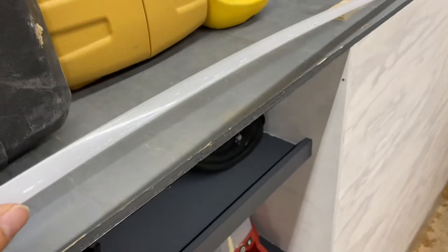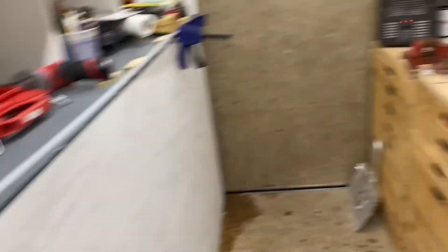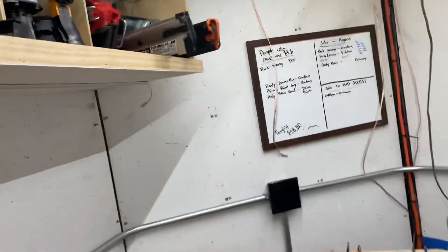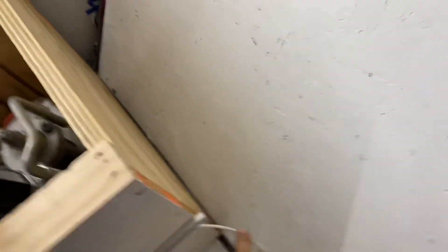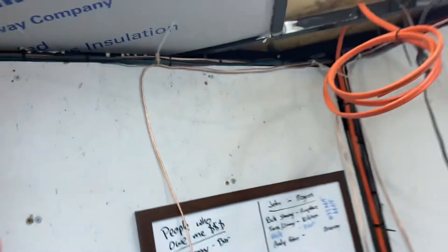So this is the little diffuser that goes on here. We have the LED into the track — I'm going to put the diffuser onto it. This LED is into its track with the end down here, ready for a snip, and then we will wire it on. The wire is probably going to duck back to that corner and then go behind the piece of trim there, up and into the main wiring harness.